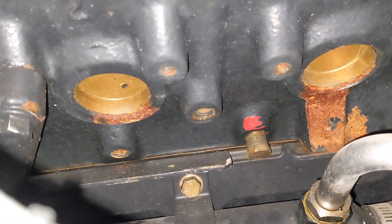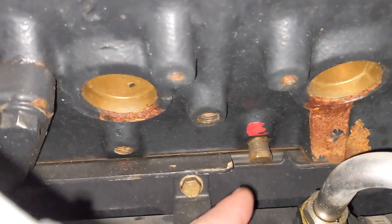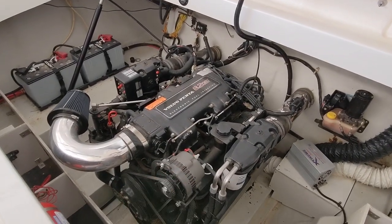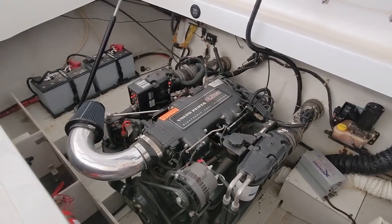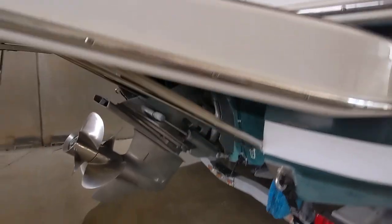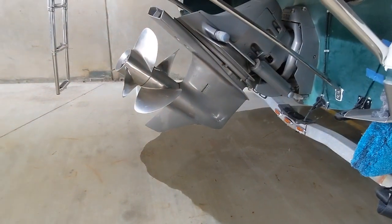And then the last thing we gotta do is drain the outdrive, and I'll show you how that works in a sec, but let's get this guy removed. Boom, done with all of the engine stuff. Now let's move on to the outdrive. For the outdrive, we're gonna keep it simple. I turned the battery on. I've got a trim switch here on the transom, and all we're gonna do is lower the outdrive,